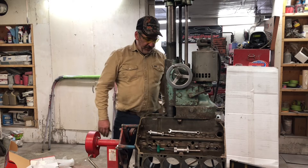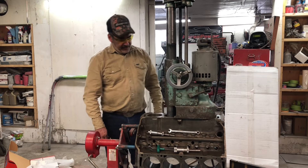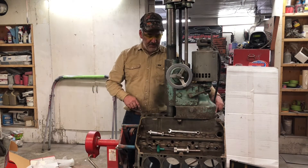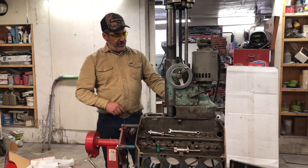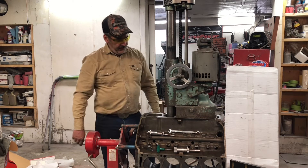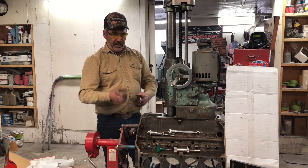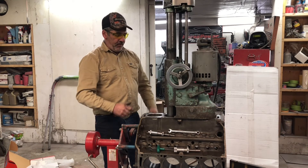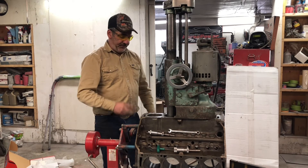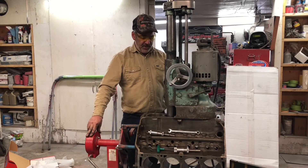You can't feel anything there — I figured it was alright, and it is. That is sweet. If you get lucky, the other three on this side will come up to the plan. I'll roll that boring bar around to this hole next, then switch my holder over to this hole and do this one and that one. I don't like to get too far over from my holder, because you want to keep everything just as secure as you can. Flat, clean, and secure — you won't have a problem. If you make a mistake, you're going to have a problem and you're not going to like the result.